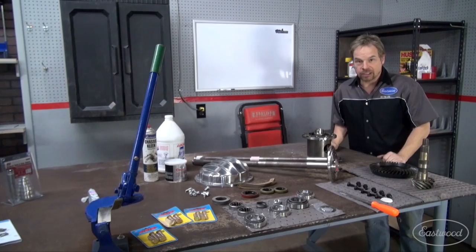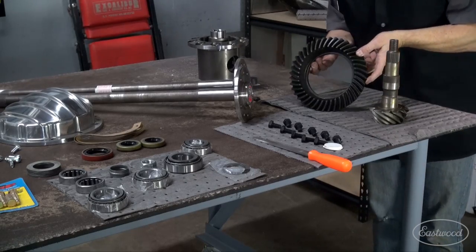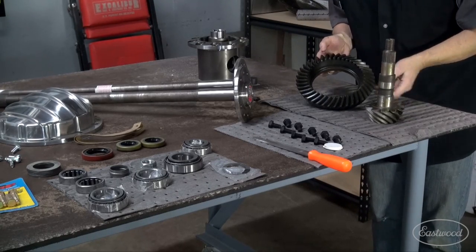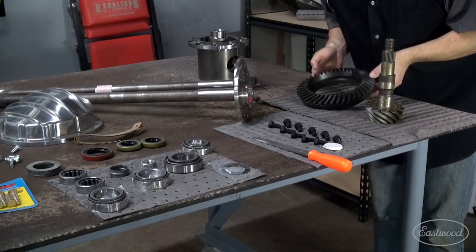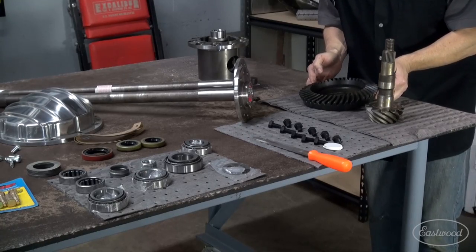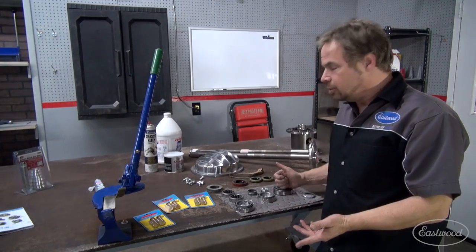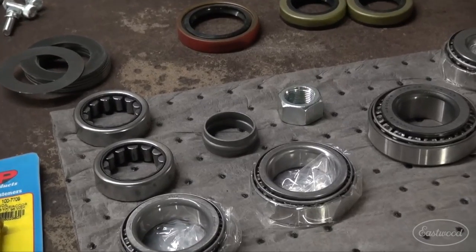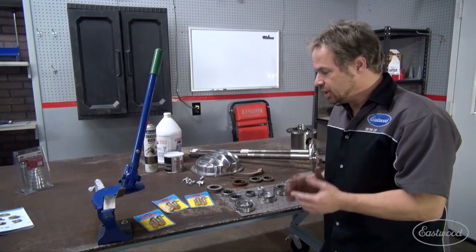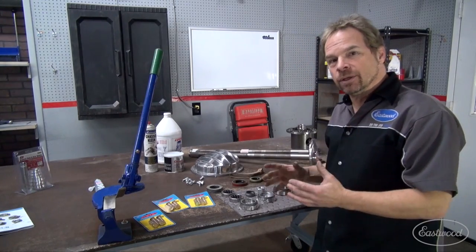This thing is going to last as long as the car lives. For our ring gear, we're staying with the 8½-inch ring gear, but going with a 3.73 combination of ring and pinion. This will really get us out of the hole nicely and work very well with our 4L80 4-speed automatic transmission. We got an installation kit from an online retailer that includes side bearings, pinion bearings, all the seals, a crush sleeve, and a pinion bolt. Don't try to reuse bearings — even on a budget, it's just not worth the risk.